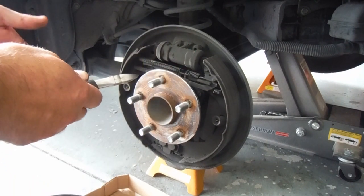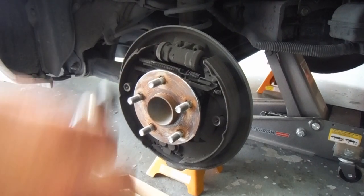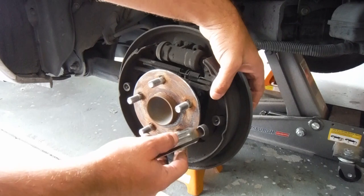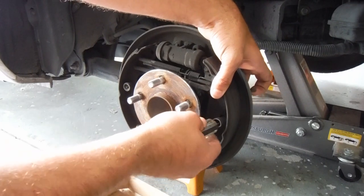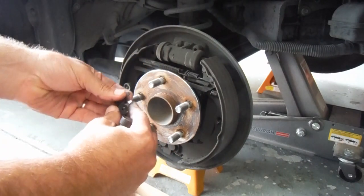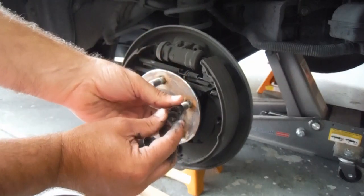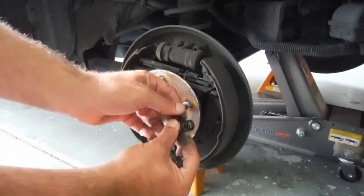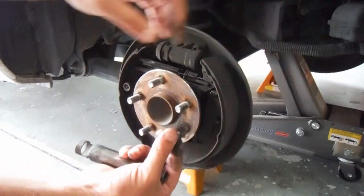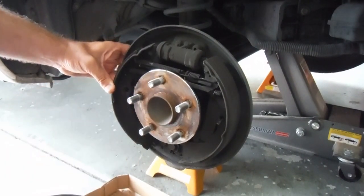You can do this with a few different types of tools. It's nice if you have the proper tool for these hold-down springs. You just push down on that and turn a quarter turn and it'll come off. You can see there's a little groove in the little retainer piece — it's like a little washer. That goes over the spring and then the little stud that comes through the back has a flat end; you just push that through and turn it. We'll do the same thing on the other side — push and turn and those will come off.